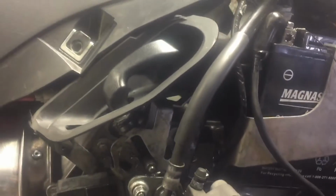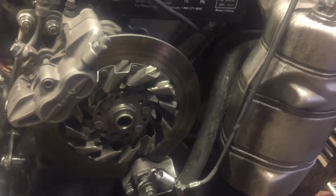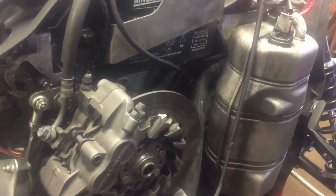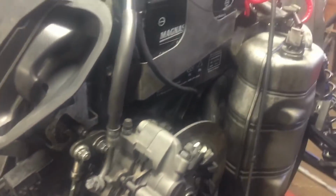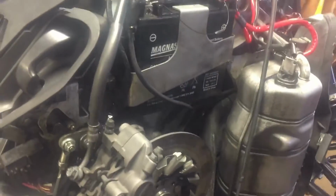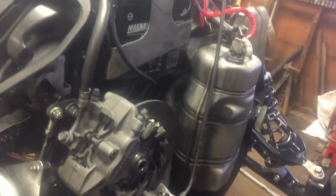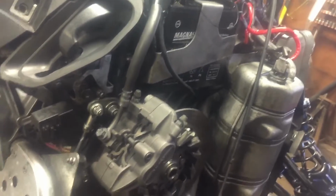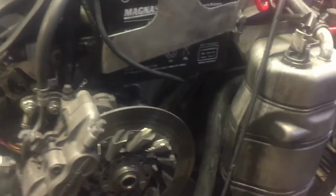So get your suspension out, then you go up here, pull your brakes off at the back, pull your assembly off, right? Get your gearbox off. If anyone hasn't done the Nytro, it's not like the Skidoos or anything. You actually got to take all the gears off individually. It's a little harder actually. So I more or less just made sure, there's a lot of shims and stuff too, that I put everything in reverse order on the table, so that way when I put it back on, I just had to flip it and get the gearbox all off.